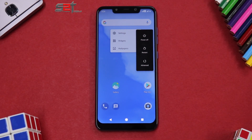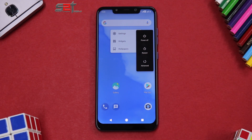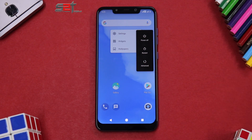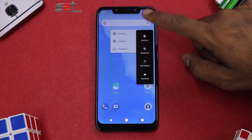In today's video we will be installing Bootleggers ROM on the Poco Phone F1. This is an install and preview, so all the usual disclaimers apply: you need more than 50% battery, your bootloader must be unlocked, TWRP should be installed, and you should back up all important data because nobody is responsible for data loss. You need to have the ROM file, Open GApps, the latest firmware/vendor, Disable Force Encryption, and Magisk copied to your phone's internal memory.